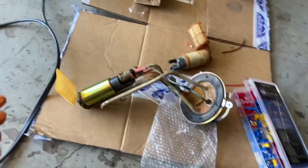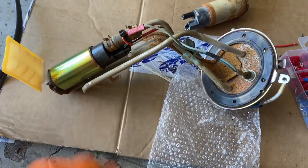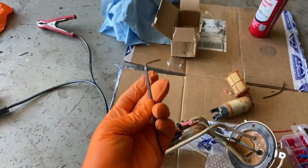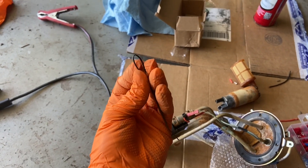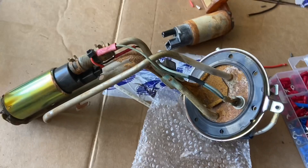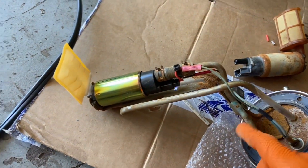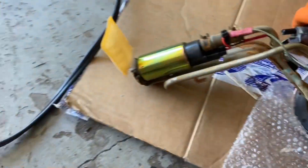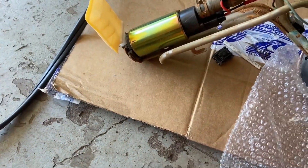So thank God — it was just a total blessing that I found on the body of the pump assembly what I was fairly certain was the terminal inside the harness. They have a piece of springy steel where the end is bent over and it springs against the terminal from the other side of the harness — that's how you get a good solid connection. Well, I found one of those tips broken off. I put power with my battery charger to the ground and up here the positive terminal, and just ever so slightly touched the harness and it would connect and disconnect, connect and disconnect. That was why I was getting an intermittent crank with no start — the connection to the old fuel pump, which is still good. I'll save that for a keepsake, because I don't have access to a junkyard to get a JDM harness. So the new fuel pump came with its own harness.